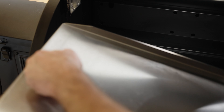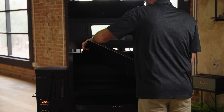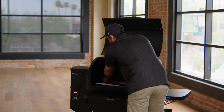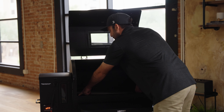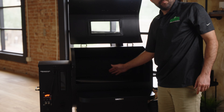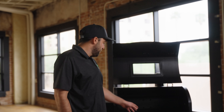With the grease tray, you're going to want to make sure this thing is set up properly. The grease tray has a circle hole cut out on one end and a half moon cut on the other side. When you set this in, you've got the circle hole cut out going to the left end. There's a little ledge near the thermal sensor — set that circle hole onto that ledge, center it with the thermal sensor, and pull it away so the metal isn't near it. The half moon cut out end will be sloping into the grease trough.